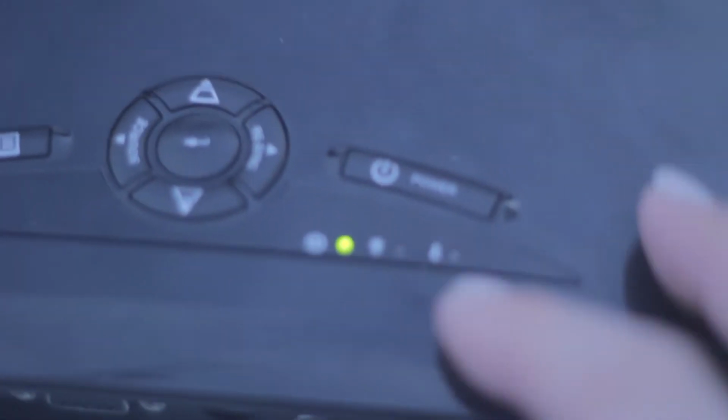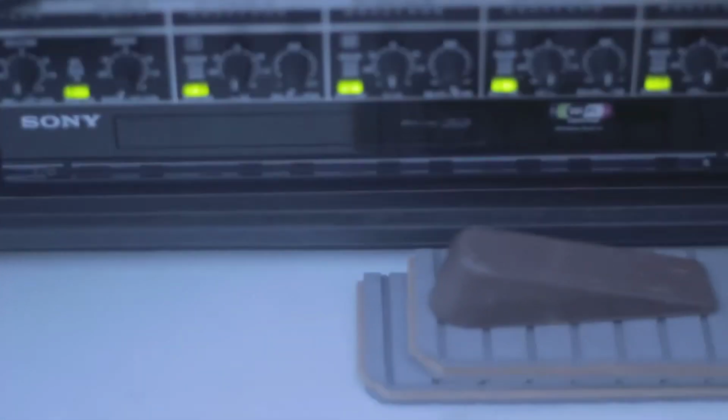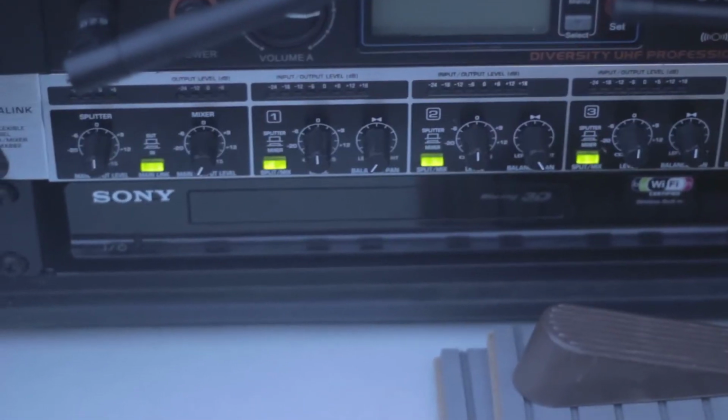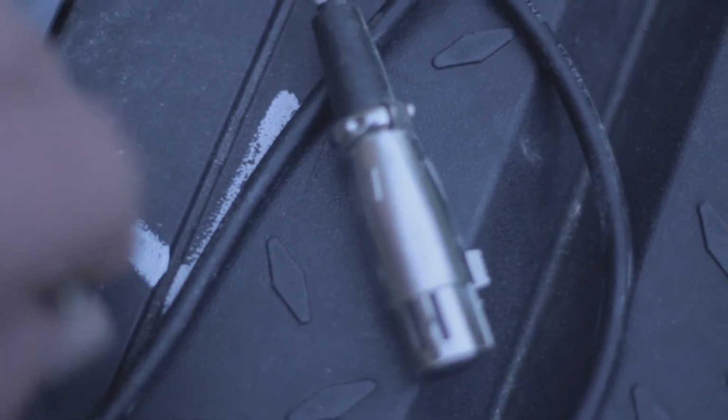Go ahead and power it on there. And you know, I had a minute to find a workaround for that bad XLR cable. I couldn't find another XLR cable, but I've got another cable where if I just put the system in mono, I can daisy chain the two speakers. So the one speaker has a 1/4" output, so I can plug that into that. From the source speaker to the destination speaker, they'll have the XLR input.